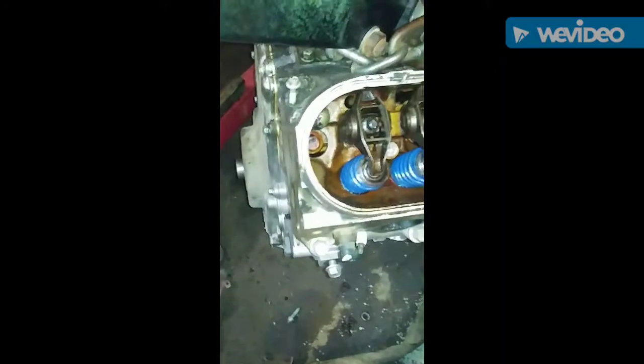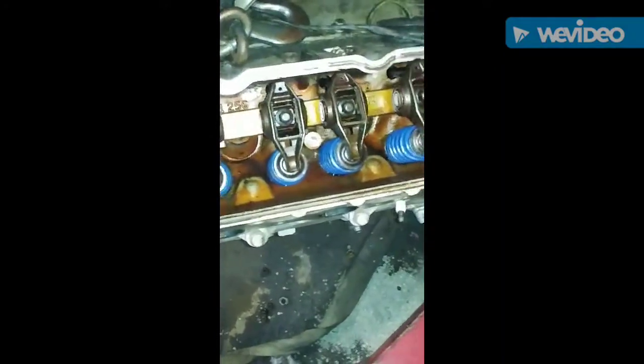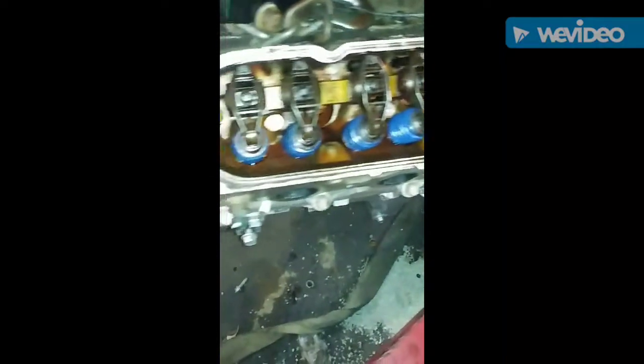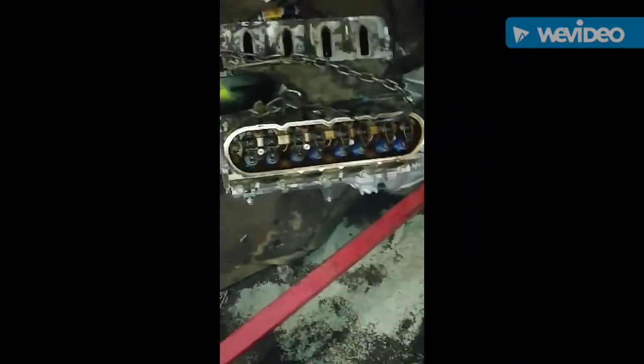Also installed the blue LS6 valve springs on there. Anytime you put a cam in there, you need to put some tougher valve springs in there, because you will break them. You will break them. So yeah, I kept forgetting and leaving this engine out of the video, so I thought I'd add this on to the end. All the work on this one has been done.